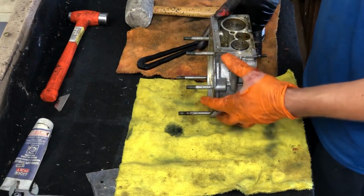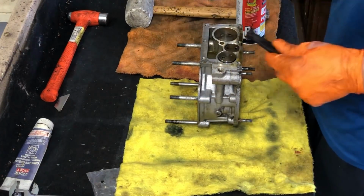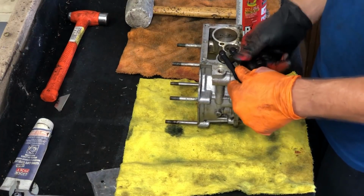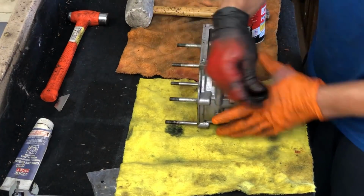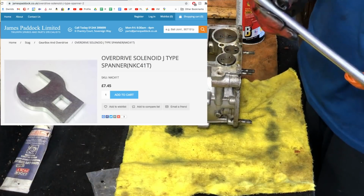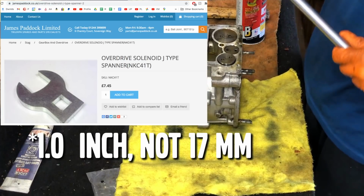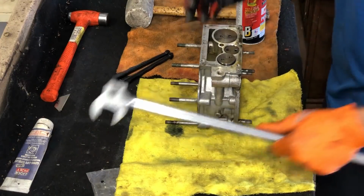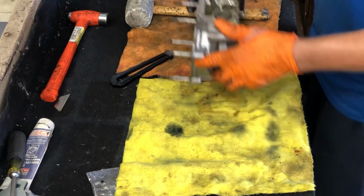These are the pumps for the valve body of the Overdrive M41. I've just been cleaning everything, so you haven't missed much since the disassembly video, but now it's time to remove these. And also, removing the solenoid, you have to get the special tool for it. It's just a 17 millimeter skinny wrench with a 90 degree attachment that is barely big enough to fit a half inch drive. You won't really mix these up, but I'm gonna pull them all out at once here.